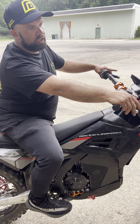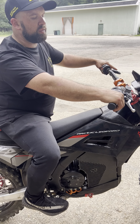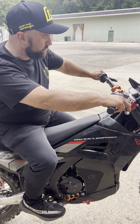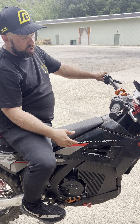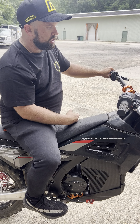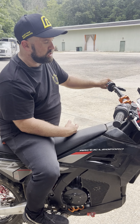Let me show you a little bit more features on the display. You can go into this display and get into more details of when you bind the battery to the bike — which we didn't do yet. You'll be able to see all your cell groups here. Then you'll also see all your battery statistics. Here's your temperatures: controller temperature, motor temperature, your line voltage, line current — these are zeros right now. Throttle voltage, which is live. You see your brake voltage — it is fully variable.